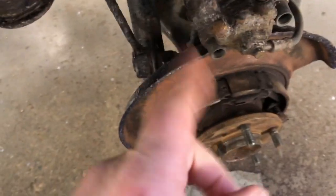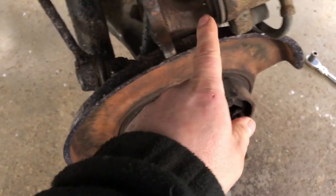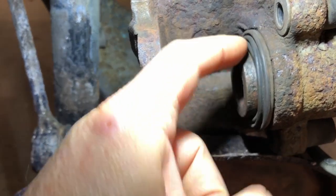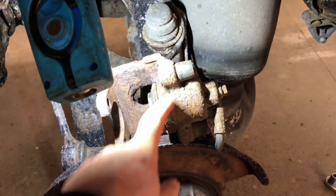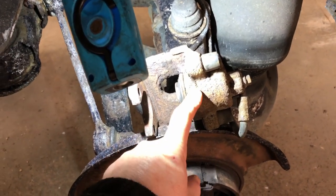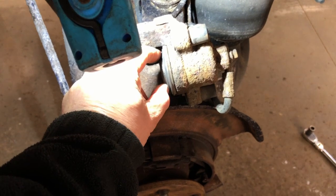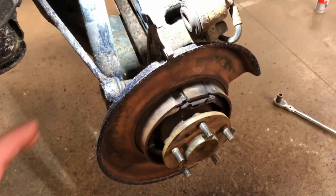I've ordered a new set of brake pads. The piston inside has got corrosion — it does go in and out but on the very end of the piston there's corrosion all around the outside edge. It's either £90 from Euro Car Parts for a whole caliper, £40 on eBay, or you can buy just a piston for £13. There's nothing else wrong with the caliper so I'm going to measure the piston to confirm it's the right size, order a replacement piston, and just replace that — it's the cheapest way of doing it.